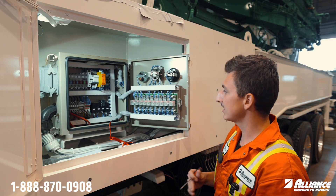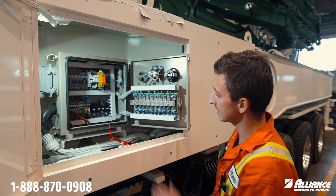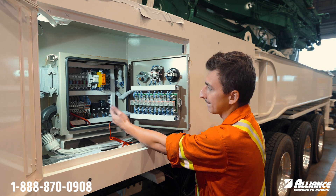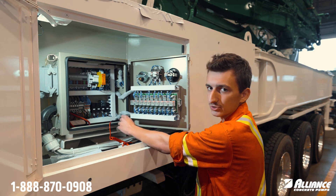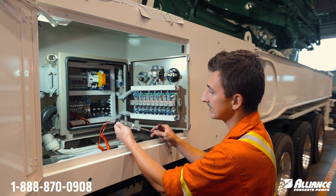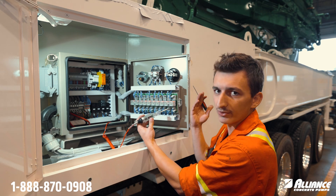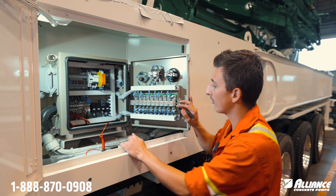Now let's say K103 is not lighting up. What you can do is take a test light — I prefer the little ground stud in here right beside your door. I always recommend testing the ground to a ground on the truck so you know it's good. Once you know that, you can take a test light and hook it up to X13, and you'd see 12 volts — 11.6 volts, whatever you get — and that would let you know this relay is getting power.